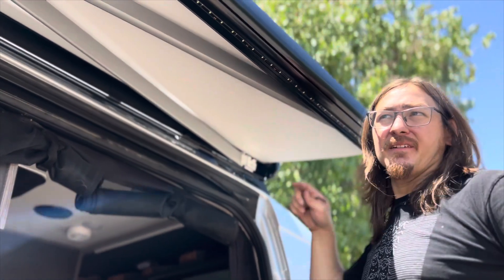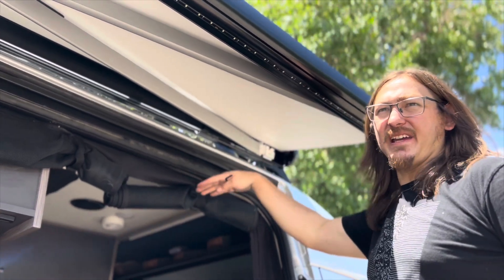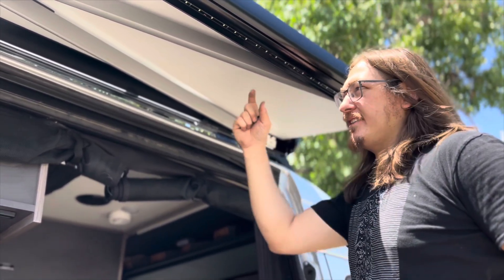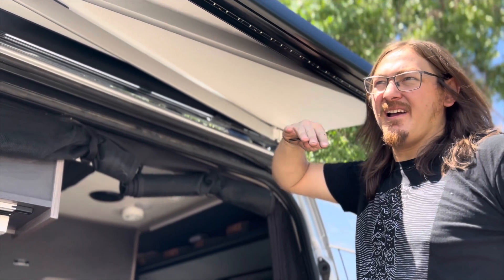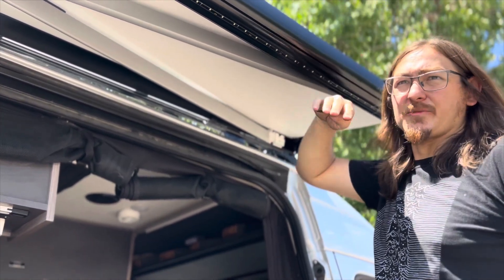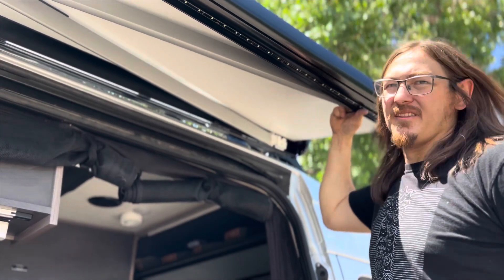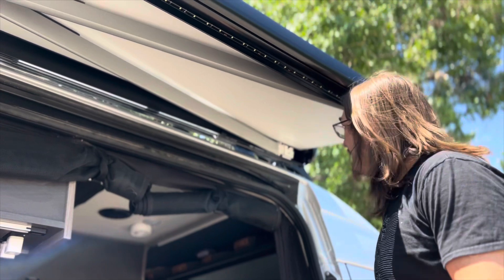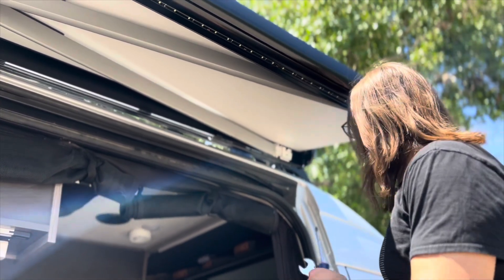What we're finding to get the awning to close more ideally — if it's super flat, your lead rail is going to stick out a little bit. If you pitch downward, you're going to have less wind catch underneath the awning, and the awning is going to close up and have a little bit nicer finish. We can actually show that at the end of the video when we close it up.